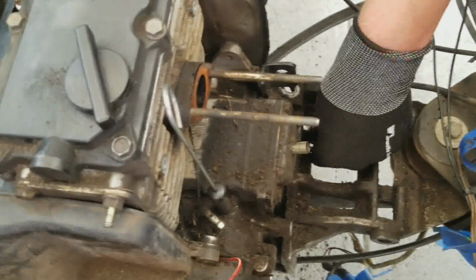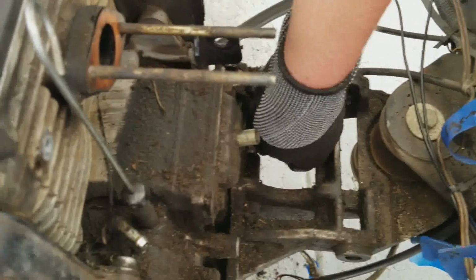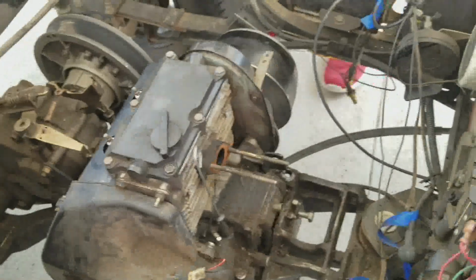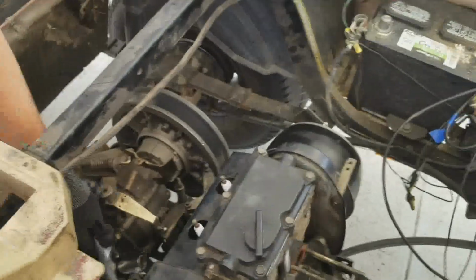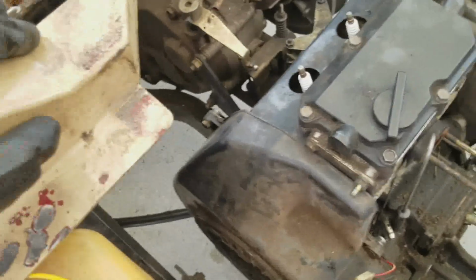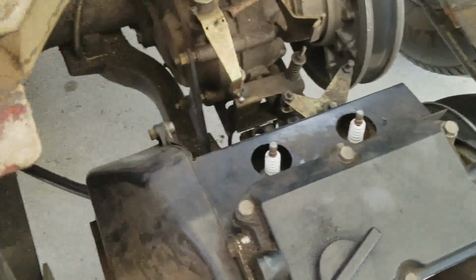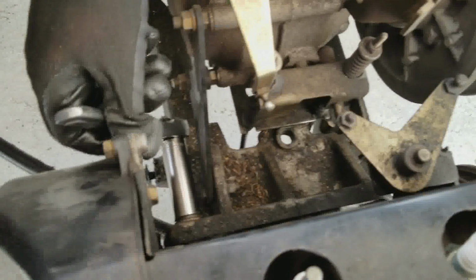Can't take that out by hand? If you want to just leave that in a hair and get the other one out. That one you can use a ratchet, right? Yeah, should be able to. I used a 3/8 drive with an extension. That's a 1/2 inch. Where's the 3/8? It's probably back in the toolbox. Same size, 5/8 deep. Oh, okay, I thought you meant like one of those long extensions. So this one you can get in with a 5/8 deep. This is the rear one, the passenger rear mount.